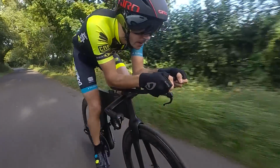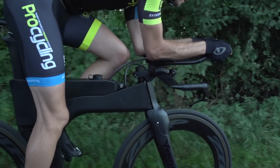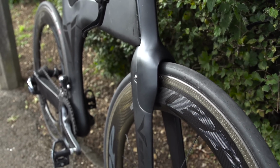The absence of the downtube is not simply to remove the drag caused by that tube itself, but to solve one of the biggest difficulties in translating wind tunnel data to the road. In a wind tunnel, the front wheel is fixed in place, meaning engineers are rather spoiled by having the luxury of completely controlled airflow from the front wheel onto the downtube, which is the most critical transition in the bike, rider and wheel system. Of course, on the road, the front wheel isn't fixed and you're making constant small adjustments to maintain balance. So you have the effect of the front wheel kind of hosing air over the downtube, so that the way that the shape of the downtube picks up and handles that airflow is absolutely critical.